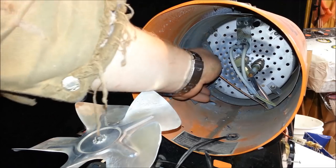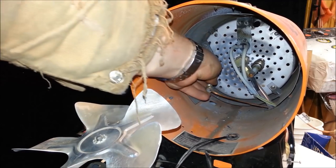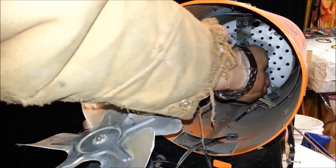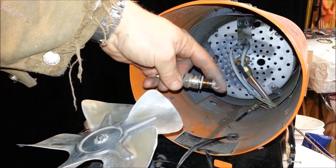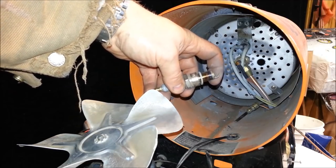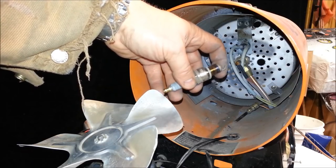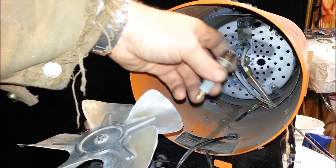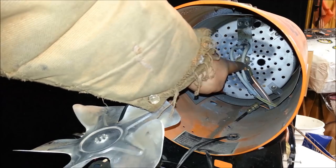This particular one is really easy — it just screws in, just unscrew it and snake the whole thing out of there. While I'm in here, pull the lead off the spark plug. These have huge gaps on them — generally about an 1/8 inch to 3/16 inch gap depending on the machine. Just look that up and make sure that's gapped correctly. The only other little thing that can go bad is that temperature sensor.